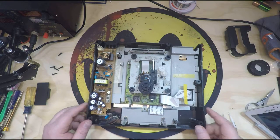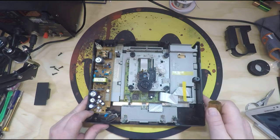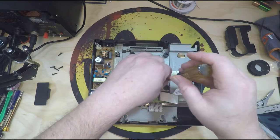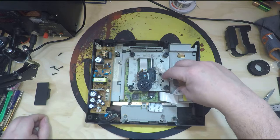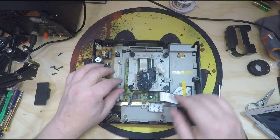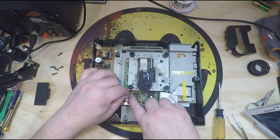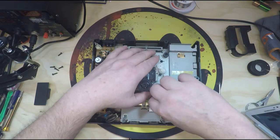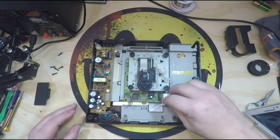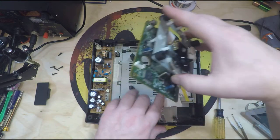What I'm guessing is somebody pushed the disc down on it too hard. Now to remove the laser assembly, take off this tether — you can either call it a grounding strap or a tether, to me it's more like a tether. If you take it apart and turn it upside down, that'll catch it before it pulls on the cords. Unplug your power cord here and pull off your information cable — it'll just slide right down in. Same with the power cable.